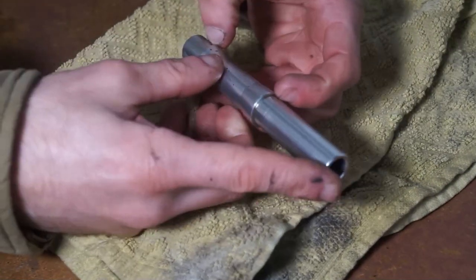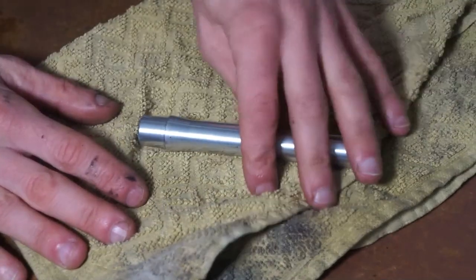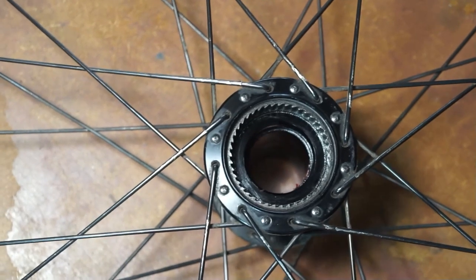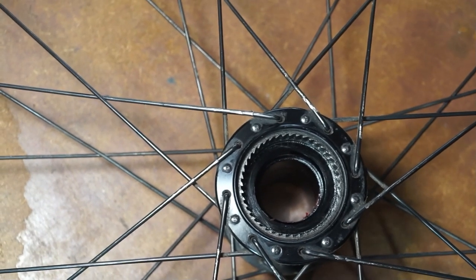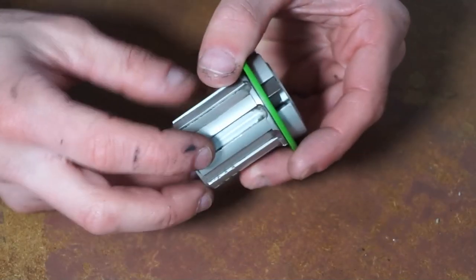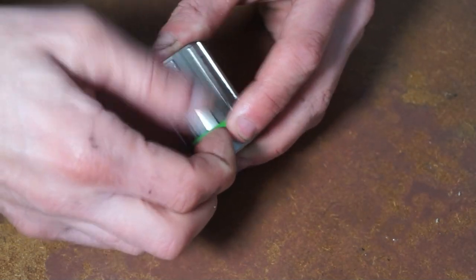The bearing butts up to here and here, and the freehub slides onto there. There are some black marks on this axle — not sure what that is. The hub is now basically empty on the inside. Just spray some IPA and use a cloth to get rid of the grease in there. Then we'll do the freehub. This is the 11-speed freehub which will also do 9 and 10 speed cassettes. First I want to remove the green labyrinth seal — I don't want it around when I'm hammering bearings.